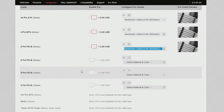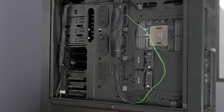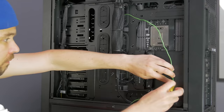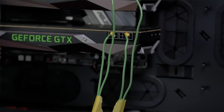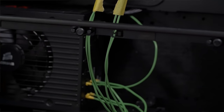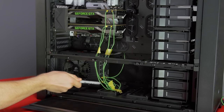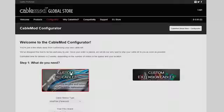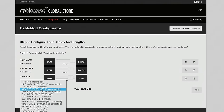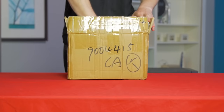We are going one step further: CableMod's ultimate offering — custom length and colored cables. To kit out your system, the first thing you need to do is measure your run lengths, but you can't just do this any old way. Don't use a string; we actually recommend using a wire. We cut a 12-gauge wire because this helps simulate the way that the custom cables will actually bend once they're installed. We're also going to try to address the clump of PCI Express cables by the power supply by calculating which cables we can run hidden behind others. It's important to get each length of run exactly right and check exactly the terminal you'll use, because if you measure them all to the same one, the end result might not align as perfectly as you'd like. With our lengths in hand, we dialed them into the configurator, which allows details like the number of pre-installed combs and distance between SATA connectors. About a week later, our PRO cables with thicker wires and pre-installed combs arrived.